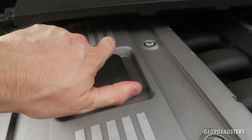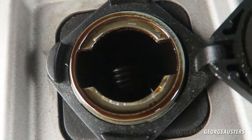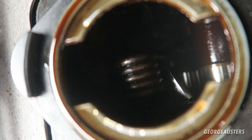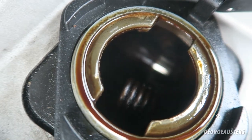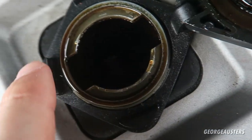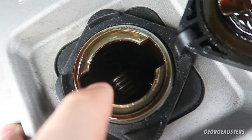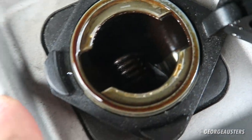So if we remove the oil filler cap — take a look in there. It is quite hard to see, but if you look at this spring right here, there is a bit of buildup. The camshaft lobe looks nice and clean, not scored or anything, but there is definitely some sludge buildup. We want to try and get rid of as much of that today as possible, and hopefully the engine flush does its job without causing any major issues.